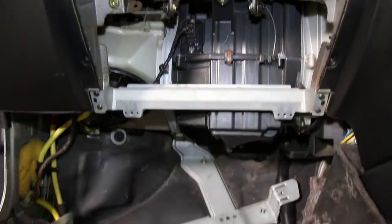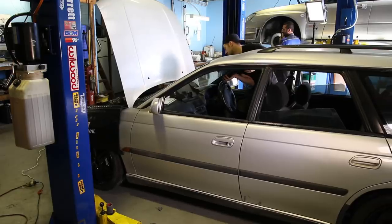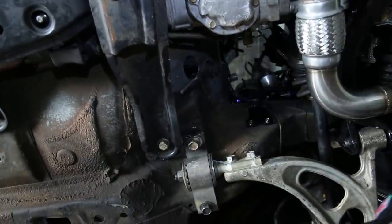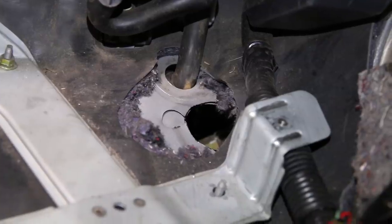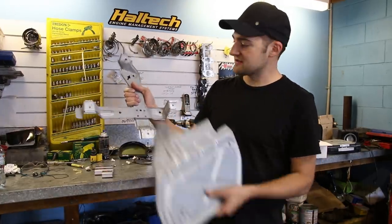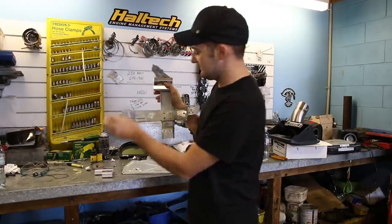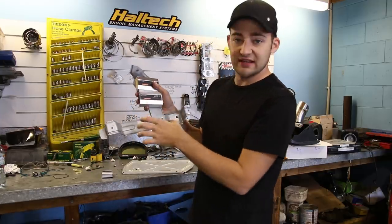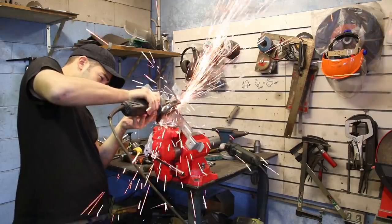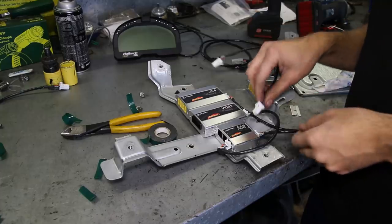We've pulled out the factory ECU and associated bracketry, but we'll need to make a new hole for the new engine loom to go through. We also need to run our EGT and air temp sensors into the car. The amplifier box will sit on our new bracket next to the CAN hub and wideband controller. This is the false floor that sits in the passenger side of the Liberty - you've got that sitting up against the floor and then a cover goes over the top. We're going to get as many of our external boxes to line up in here so that they're attached, easy to get to, and won't get squashed by people with big shoes. The controller boxes can then be attached to our new bracket and the short CAN patch cables plug together.